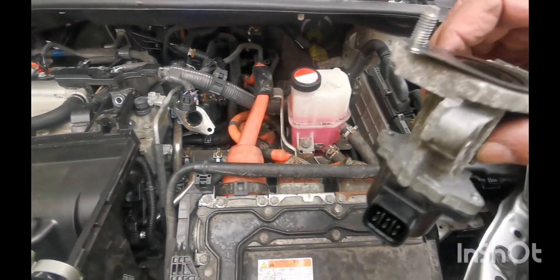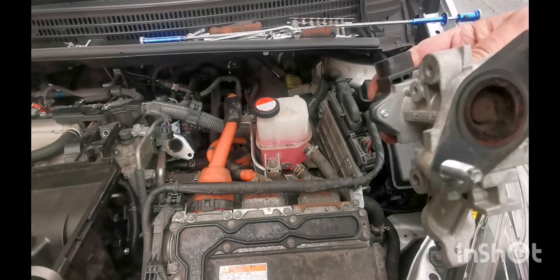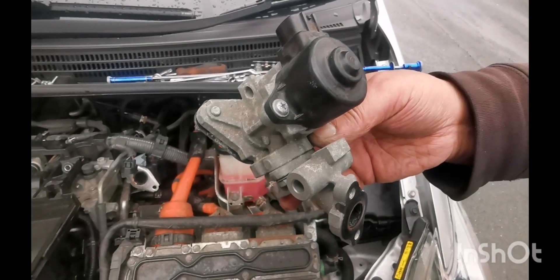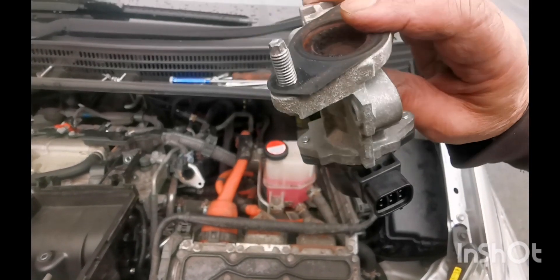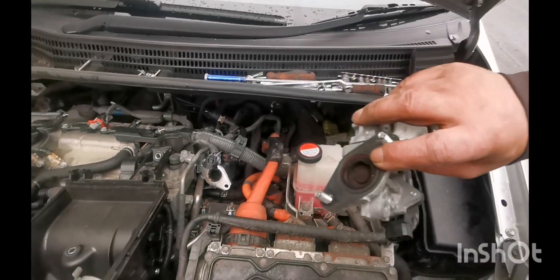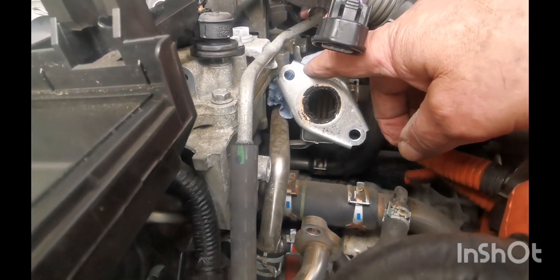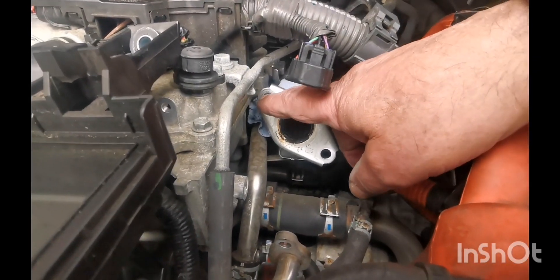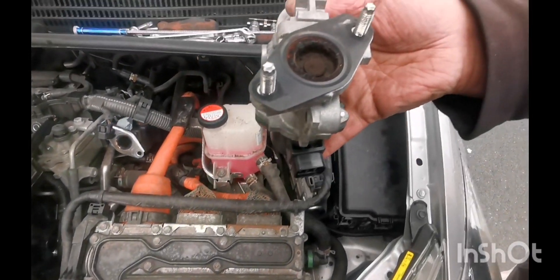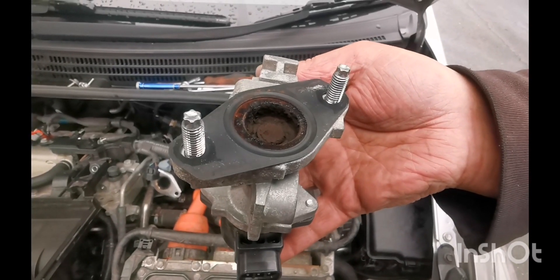This is the EGR valve. After repairing this I think it would be better to show you again whether it was this EGR valve causing the issue. My hybrid battery is also weak — I'm going to replace that afterward — but this is my first time taking off an EGR valve. I experienced slight difficulty but fortunately managed to take it off. I used a spanner at a different angle as a plate here was preventing it from reaching the bolt. I hope this will solve my problem.